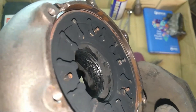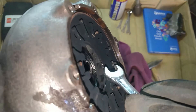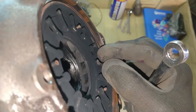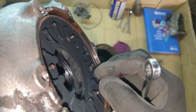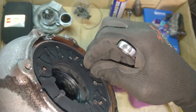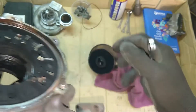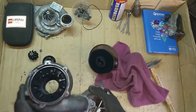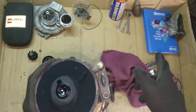I don't know if you can see on the video, but these arms are attached to little vanes in there. So when the arms rock back and forth, it manages how much airflow goes into the turbine wheel — that's actually how the variable vane system works. Each of these has a hinge and is able to swivel around. This ring basically attaches to all of them, and then it's controlled by the swing arm on this side, which is then controlled electronically by the actuator.